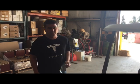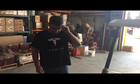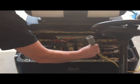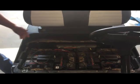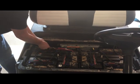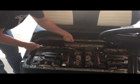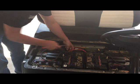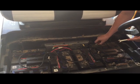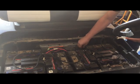After two weeks we've watered the car, we've double charged it, and now we're going to do the disconnect in real time to show you how fast this process is. We have our safety glasses and a wrench that I've wrapped some electrical tape around so we can't short out the two posts. First we're going to unplug the charger from the car and move the tow-run switch from the run position to the tow position. We'll take our first battery and disconnect the nut, set it off to the side, pull the charging wire off, and then the main red wire. Then we're going to walk around to the other side of the vehicle and disconnect the main negative post — and we are done for the winter.